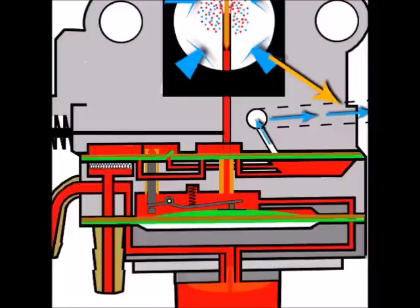This air being drawn in and out of the airline shouldn't be confused with the air going in through the inlet — they are two separate systems. To recap: air from the piston creates pressure and vacuum on the diaphragm, making it pump up and down efficiently. It pushes fuel past the one-way valve flap, down past the needle valve into the metering area, then up through the main jet — drawn by the vacuum of incoming air — and out into the venturi.